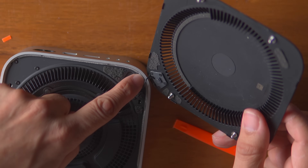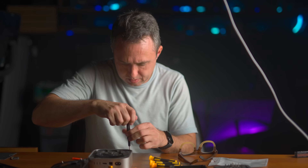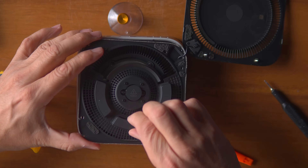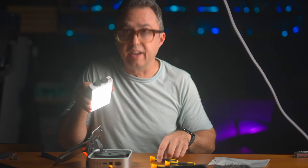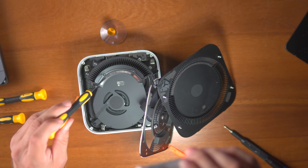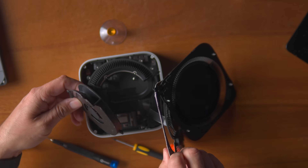I'm just going to fold that over — you can see there's a little connector there. Once you get in here, there are eight T5 screws around the edge to take off; you can keep the ones in the middle. I had read this was T4 but that's definitely too small. Once those are off, give it a wiggle and the layer comes off pretty easily. There are power cables on the corner and a ribbon connected to the fan assembly. On the next layer there are two T5 screws and two smaller T3 screws on the heat spreader or air diverter. Then the fan just pulls off — it has its own ribbon going the other direction, so be careful. And we have revealed the Mac Mini SSD.